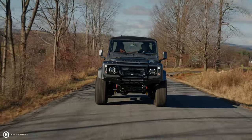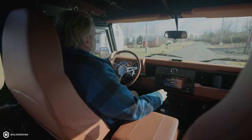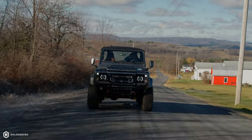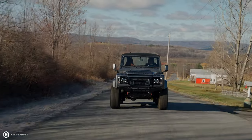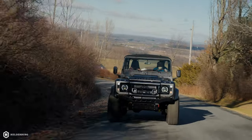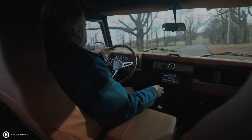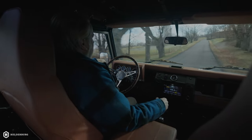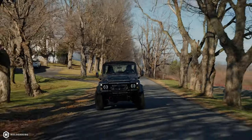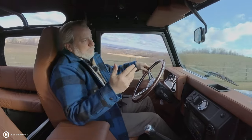Speed-wise, yes it's lifted, and yes it's peppy. You would definitely be able to exceed highway speeds. You'll notice how easy it is to steer — I can steer with two fingers, no problem. It just handles well, and that's part of the process because it does have power steering assist. It's not like driving a truck; it's not sloppy, the steering wheel's not all over the place. You can drive with two fingers and shift with two fingers. Being a manual transmission, we rework the clutch slave and the spring, so you can depress the clutch very easily — it's actually doable with two fingers, a lot like stepping on a brake.